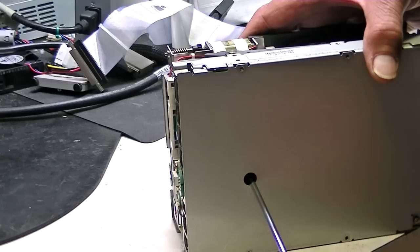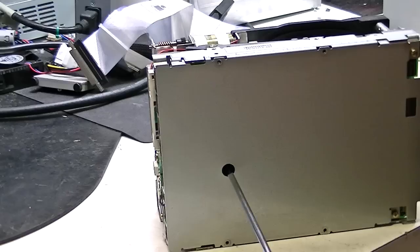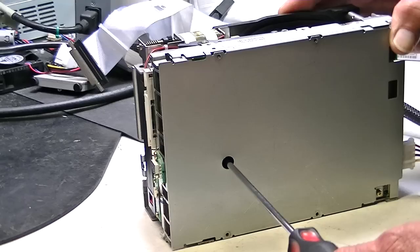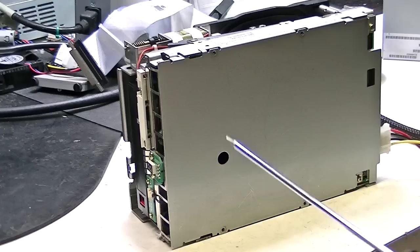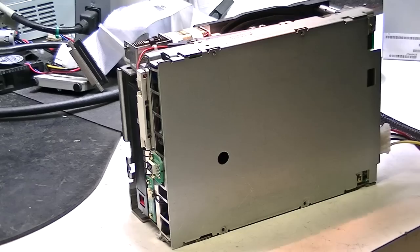Here it comes — we lucked out on that. The leader pin assembly came out. Typically it will go all the way across here before it comes out, so consider yourself kind of lucky. At this point, what you need to do is insert the Torx in here again and continue to take up that tension in there — we should get that back in. Let me just check to make sure that it went in. Kind of looks like it did.